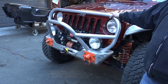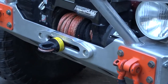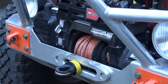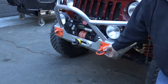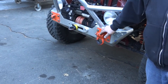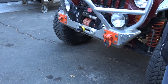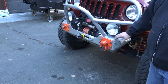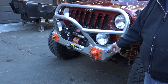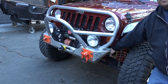It's a great bumper. What's nice about it is it has a metal tray that the winch bolts to. I also have that metal tray welded to the frame because I also use these shackle hangers a lot, and we also flat tow off of these shackle hangers. So to me, it was important to have all that, you know, gusseted together. So being that the winch plate is all welded, these are plenty adequate to pull off of. We've got a little plug here for the Roadmaster tow wiring. We also have a couple of D-rings welded on the frame back here.